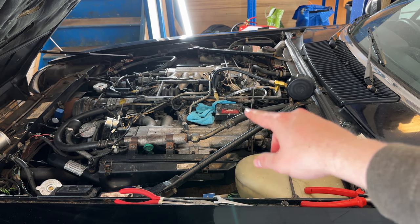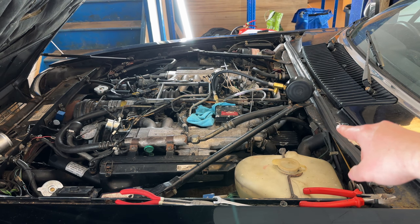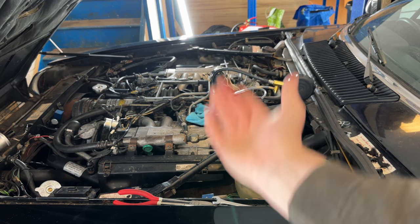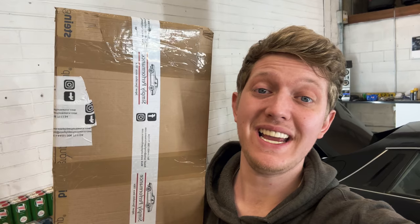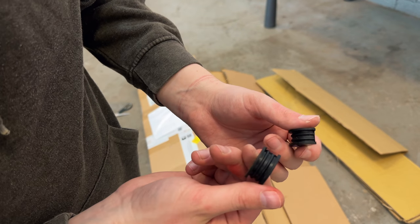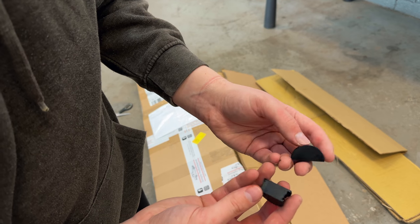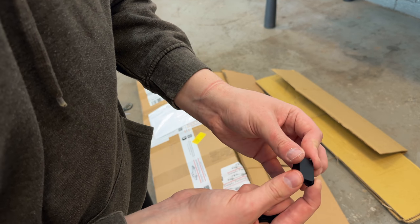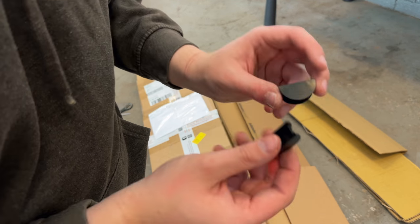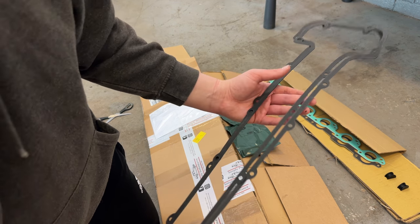I've got to take this injector rail off, all of the injectors. I'm also going to take these cam covers off because I need to do the half moons behind the camshaft. That means I need parts - gaskets, intake gaskets, etc. That is where Simply Performance Jaguar Specialists have come in handy getting these parts for me. Those are the rubber half moon gaskets - the OEM ones. But I have actually upgraded these; they are going to be aluminium, which is pretty cool, and it means that these won't have to be changed because the rubber does dry up over time and perish.